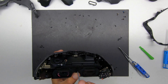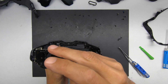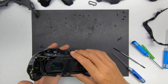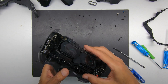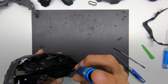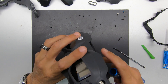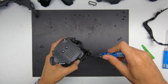Now I'm going to be pulling the last screw out of the main goggle module. With that screw out, you have to be very careful, because now we have the antenna wires for all four antennas still wrapped in there and we're going to have to try to wiggle it out through those antenna wires, because I didn't really want to pop the antenna part apart.